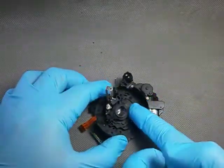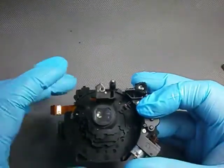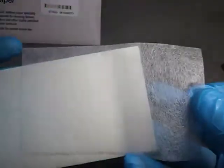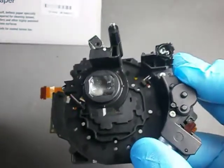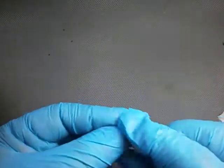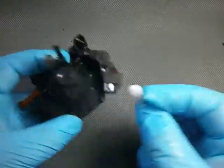I've already removed most of the debris with a blower and a makeup brush. It is time to clean the focusing lens. For this I will use lintless lens cleaning paper. You can see there is still some dirt attached to the lens. I used a generic lens cleaner together with a cotton swab wrapped with the lintless paper and gently applied it to the lens with a circular motion. The other lenses in the barrel cam were cleaned that way too.